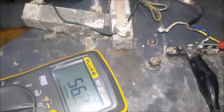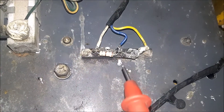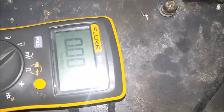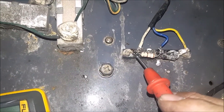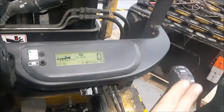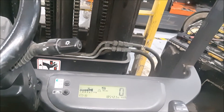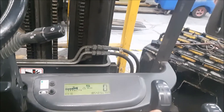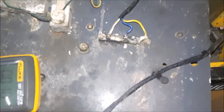The next thing to do is replace that resistor. I've soldered in a new 180-ohm resistor from the local electronics store. Checking the output again where we should have 24 volts — it's back! Now testing it out: lift it up — goes up. Lower down — there it is, it lowers.